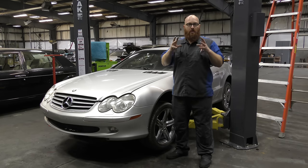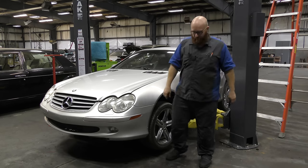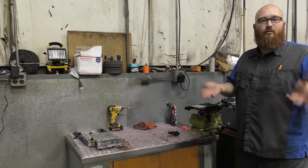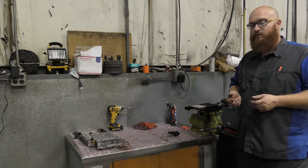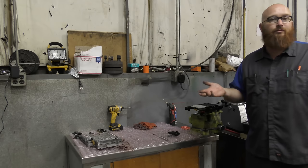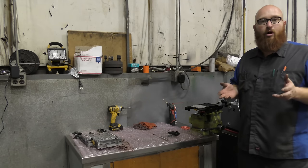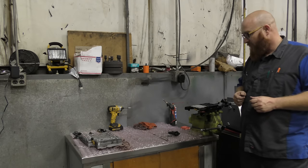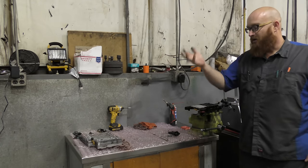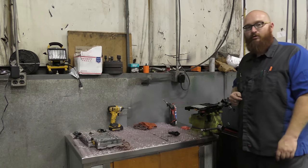But first I want to show you guys another project we're doing. We're not going to do an in-depth video on it, but this is a common issue and how you fix it. We've been driving Mrs. Wizard's SL500 around for a while and it would go into limp mode. It would shift really weird — it felt like the transmission slipping. It wasn't. It was just staying in second or third gear. I scanned the codes and found out the problem: it was the turbine sensor inside the transmission, which is located on the conductor plate.